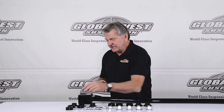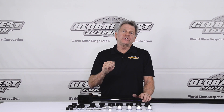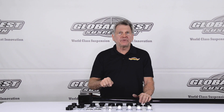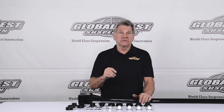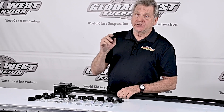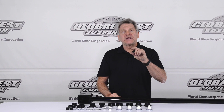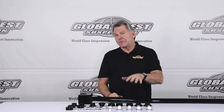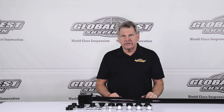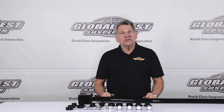This is something you want to do when you're building the car, not afterwards, because when you do a drop like this there are things that are going to change in the vehicle. First, your air cleaner to hood clearance is going to lose 400 thousandths. So if you're running a tight situation with a high-rise or whatever and that air cleaner is right at the edge of possibly hitting the hood, you only have 400 thousandths left — you might want to check that out.